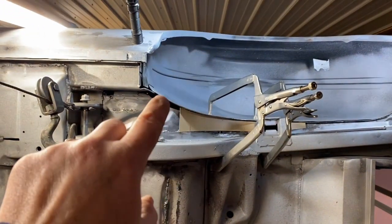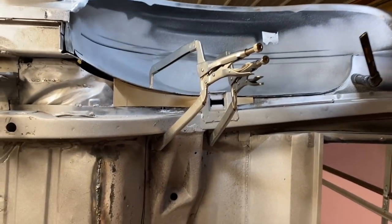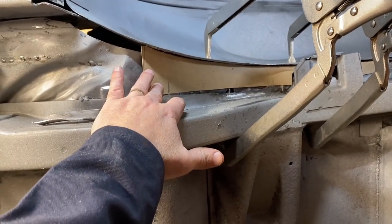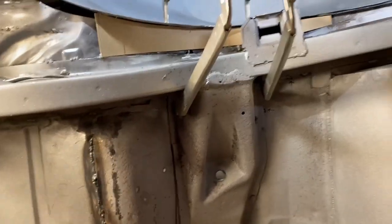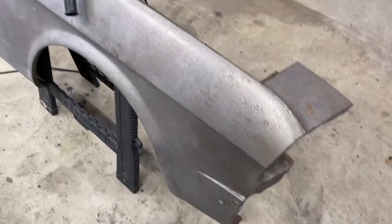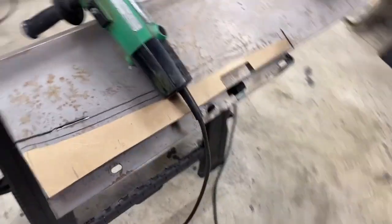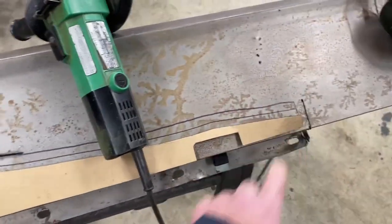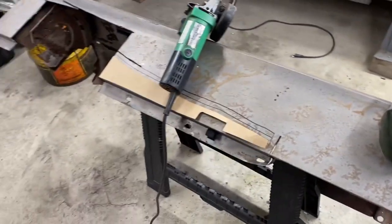For those of you who know, you are probably cringing like crazy when I was talking about cutting that. So I think my next thing is going to be to cut this into a piece of sheet metal, form that lip on it, and then fit that in there. I have the sacrificial fender out, took my template, traced it. I'm going to cut an extra half inch wide on it to make the flange, and we'll see how this works.